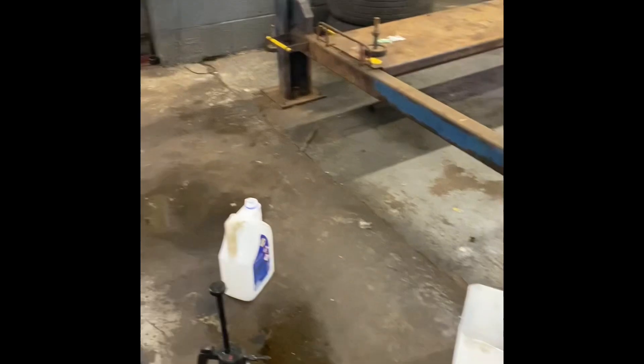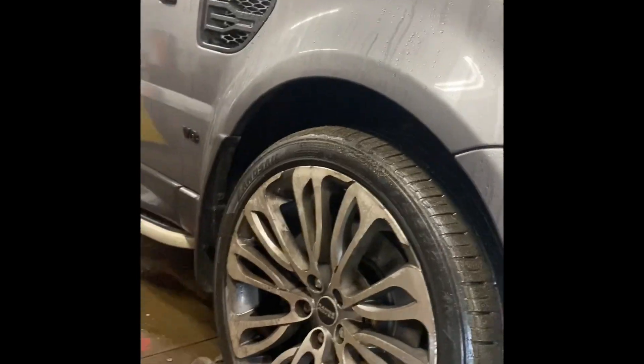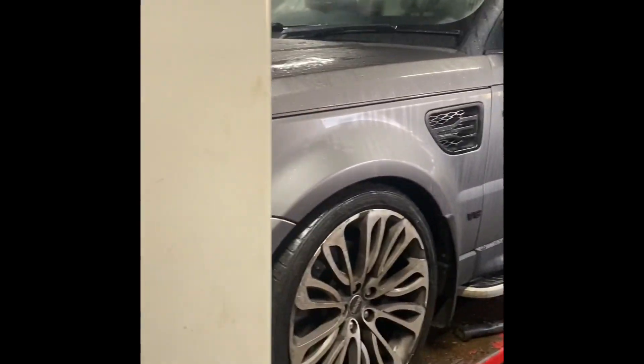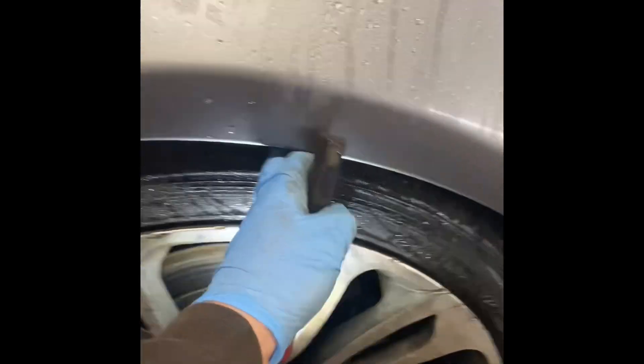So that's basically what's going to need replacing — that front air spring. It's pretty obvious now: when the suspension actually went up and tried to reach top height, if you look where the car's sitting, it's not right. You just get three fingers in there and you can more than easily get your fist in there. So yeah, it's the air spring.